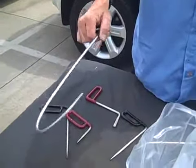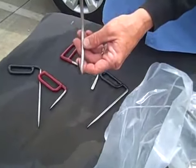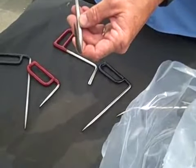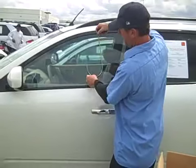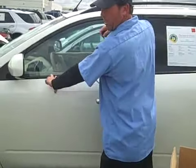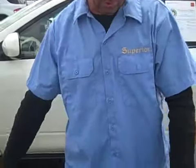Here's one tool right here. This is what we call a J-hook. The tip is CNC machined — you see how sharp it is on the tip for nice cutting action for getting into those tight areas. The J-hook, for those of you that aren't a PDR tech, is mostly used for going down the glass on a vehicle. We'll put a wedge in here, come back up and hook up underneath the top brace that's almost evident in most vehicles. J-hooks are a great tool and you get a couple in every set.